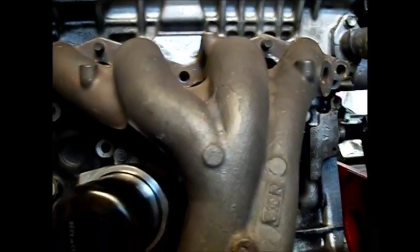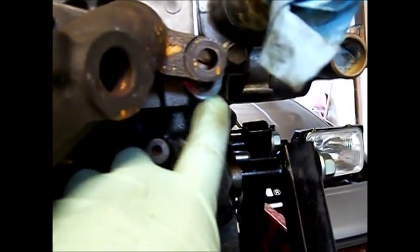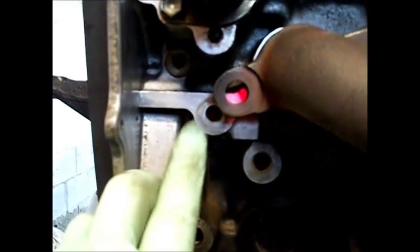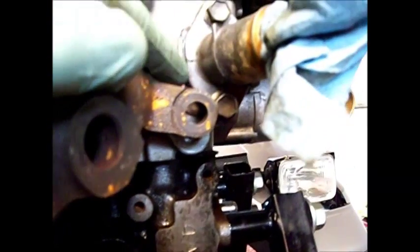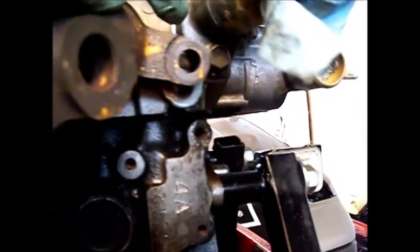The problem, as you can see here, this is a 16-valve manifold. I put it on the exhaust ports here with my new Silvertop 20-valve, and you can see they line up good except for the end ones. The end tabs are off on both sides — this one's quite off, and this one actually hits the heater outlet or inlet.